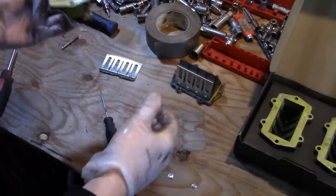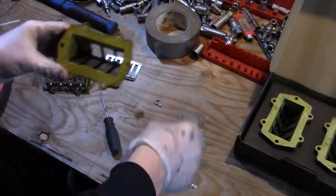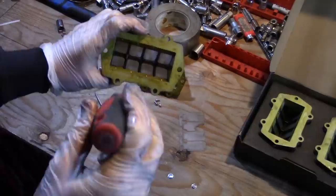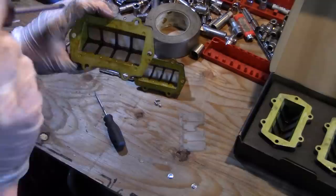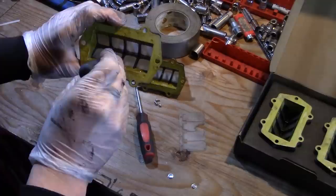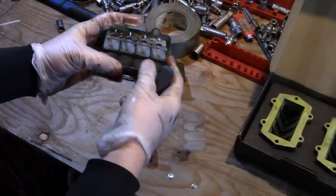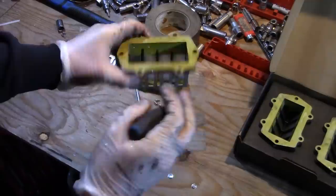If you're not familiar with how a reed valve works or exactly what they do, let's go over them real quick. Basically all this is, is a check valve for air. I'll use this one - I don't mind wrecking these because they're already pooched. So in the bottom end of your engine, that's where your charge goes in. Primary compression takes place there. Your air goes in through here one way - it's a check valve for air. So air is able to come in that way, able to be pushed in. But when you have compression from the other side, those flaps don't allow air to come back in. So air can go in smoothly this way, but air cannot come back out the other side. There's your primary compression - that's basically how it happens.